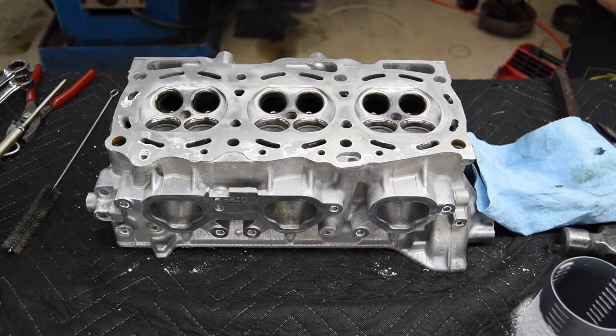So this is a high spot, and it's possible it came from the locks, but because it looks like a strike mark that kind of goes through here, and then maybe down through here, it might have been just how they disassembled it. So I'm going to have to get a little bit of crocus cloth to clean up this top piece and make sure that it goes through.